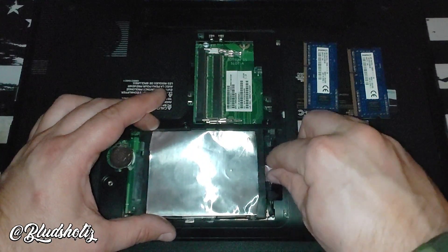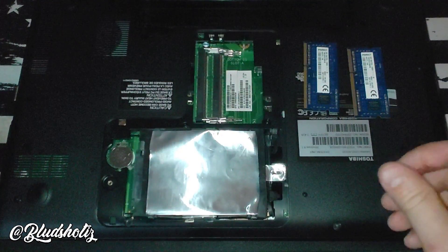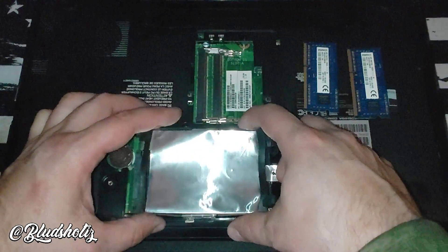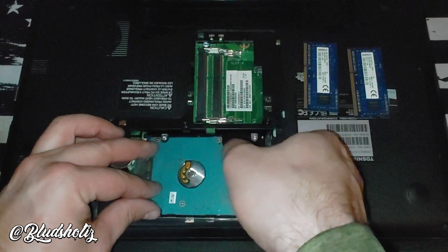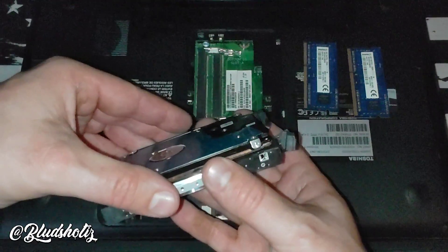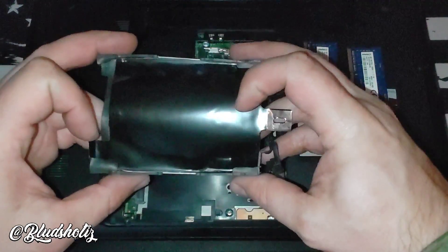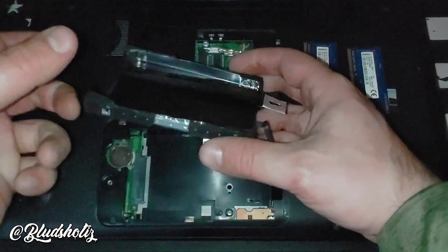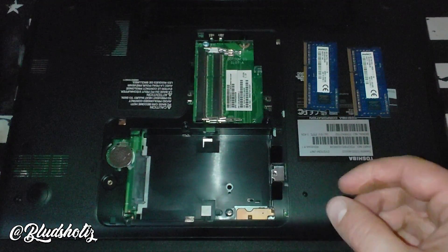This right here has got one screw. Pull that screw, then there are two rubber tabs — you'll pull those up and pull the SSD out like this. It'll be in a cover, so right here is the old hard drive. Pull that out, install the new one, put that cover over it. On the sides there are metal pins that fold into the new hard drive — you'll push them in with a flat head. I've got precision screwdrivers I'll press back into the new hard drive to set that. It's just a static coating so you don't get static electricity buildup.